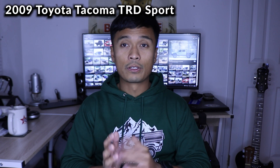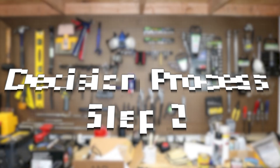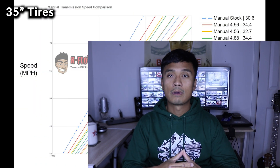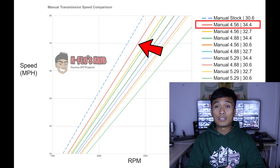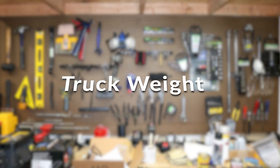I have a 2009 Toyota Tacoma TRD Sport with a four-wheel camper, 35-inch tires, and a manual transmission. The second part of the decision-making process is picking the wheel and tire combination you want to end with. I have 35-inch tires, and the closest to stock speeds would be 4.56 with 35-inch tires. The third step is to figure out how heavy your truck is planning to be.